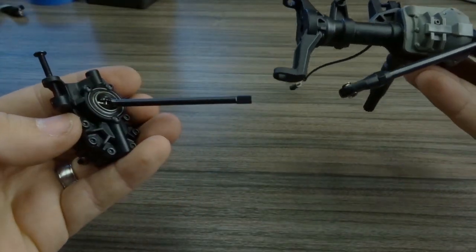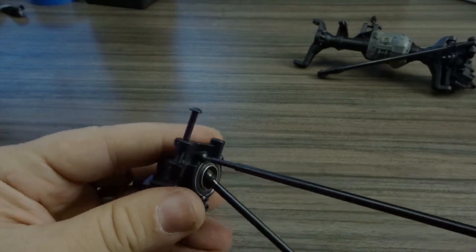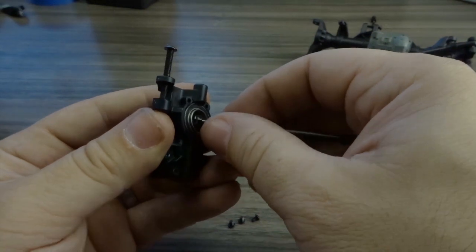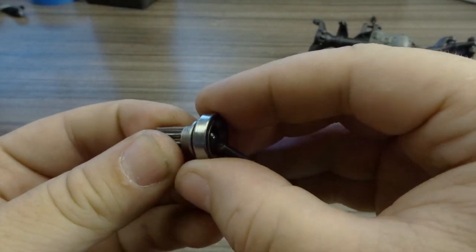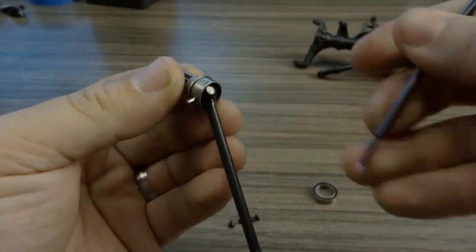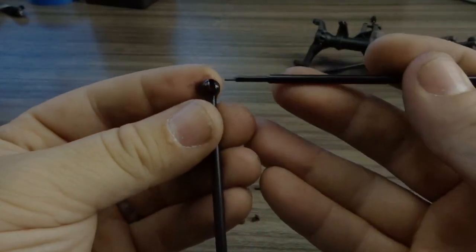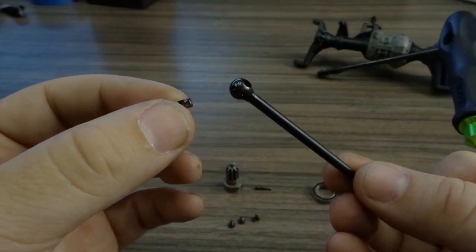We can then remove the portal and the inner axle shaft will follow. The inner axle shaft is attached to the upper portal gear. There are three small screws that retain the inner bearing to that portal in place. Remove those three screws and at that point you'll be able to use the inner axle shaft to help pull that gear and bearing out of the portal. You can remove that outer bearing and that will give you access to the pin that constructs the CV joint. You can push that out with a small driver, allowing you to separate the inner axle shaft, the pivot pin inside of that inner axle shaft, as well as that upper portal gear.